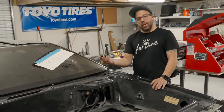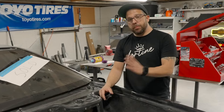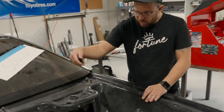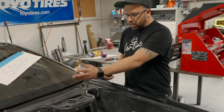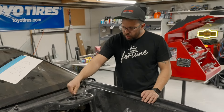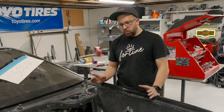We're also going to be getting rid of our gas cap location, which is really a pain. If you own a DeLorean, you've got to pop your hood, take your gas nozzle over your nice interior, fill it up, and get gas all over your cowl and inside. This does not work for us. So we're going to exit the fuel filler out the front fender, just like an old school Porsche — it's going to be really cool.